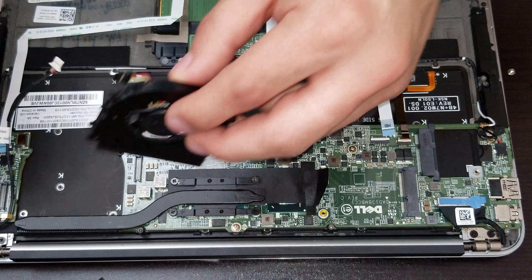We put the actual screw back and the locker for the keyboard. Remember all the screws — the small screws go under the K. Now we are able to put the jack connector, or the AC power adapter. Make sure we put it in place, and after that we screw the actual power jack in. Then we put the little board in place, and on top of it we have to put the actual speaker — make sure you put back the connector and put the screw back in.